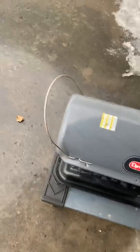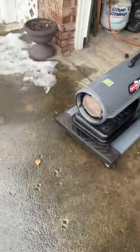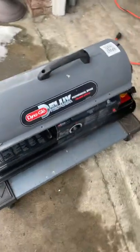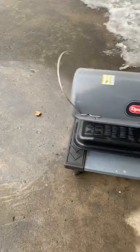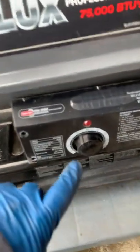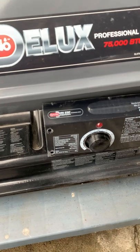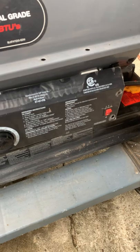This year I went to fire it up and it started spitting fuel out the front. You might be able to see some of the spills there. The motor would run, the fan would spin, it would just spit fuel, and then it would shut off after about 15 seconds.